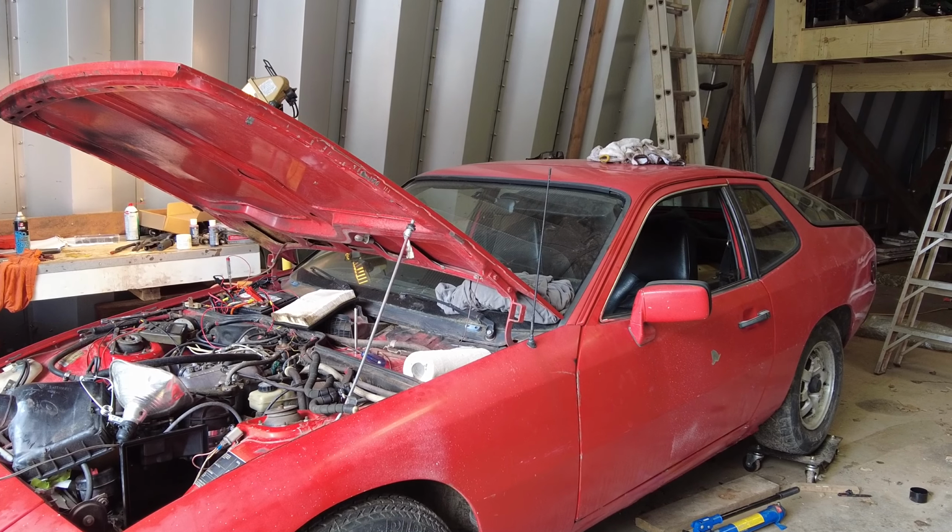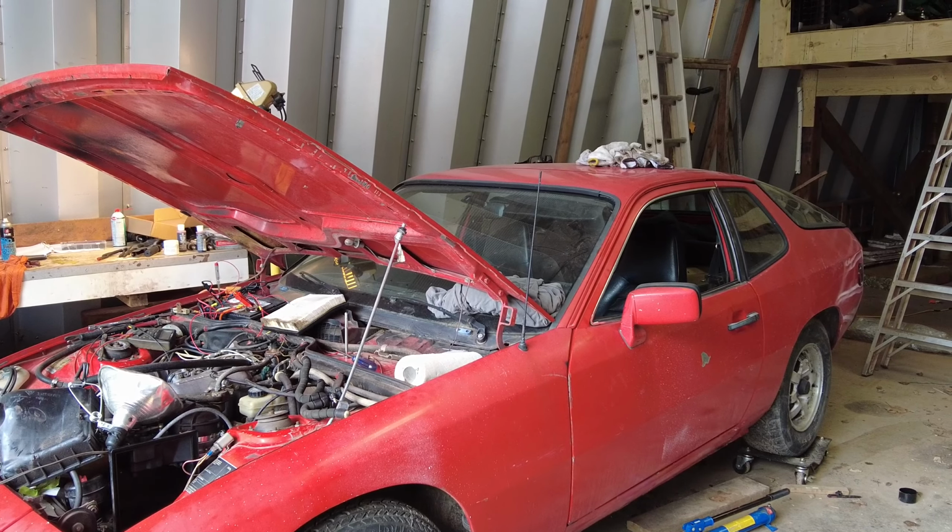The fuel accumulator is like a, I don't know if you have a pressure system for your water. I have a water well here and I have a pressure system on it, and the water pump fills up a pressure tank, and the pressure tank makes it so that the water pump doesn't have to jar all the time. It's got like some elasticity to it. So I think that's the same thing a fuel accumulator does. It allows the pressure to build up and makes it so that the fuel pump can keep up with the pressure requirements. Anyway, that's all I know for now. When the accumulator gets here, I'll stick it on and then see if I can get anywhere with it. Now, that's it for this one for today.